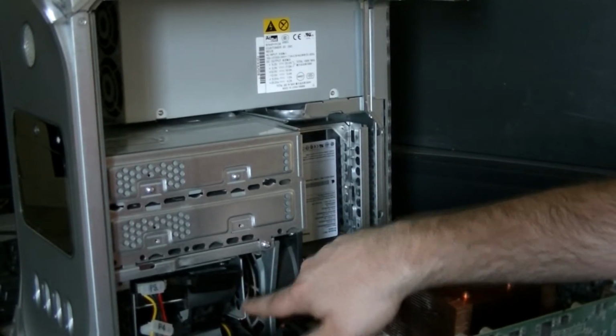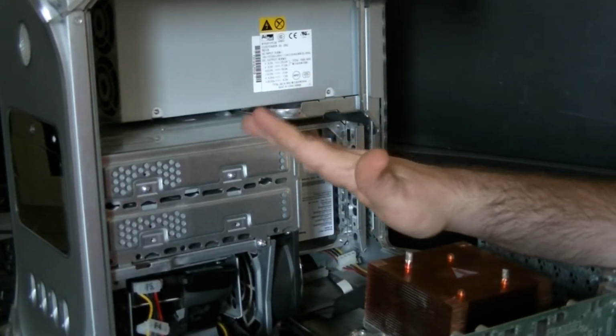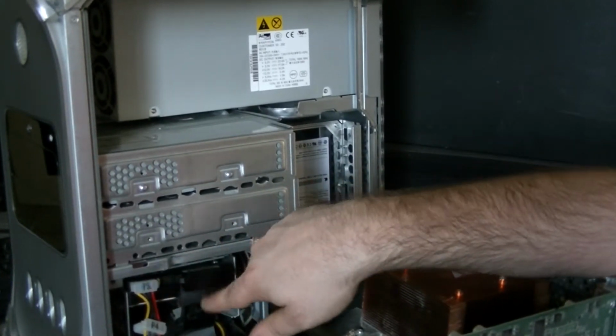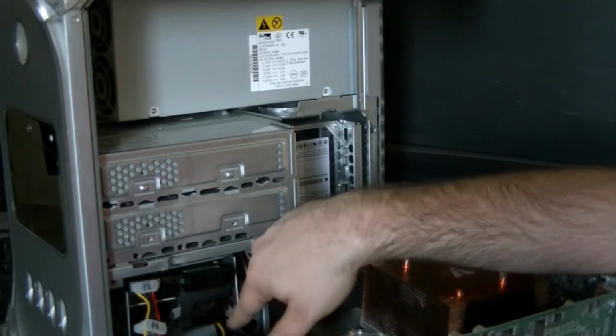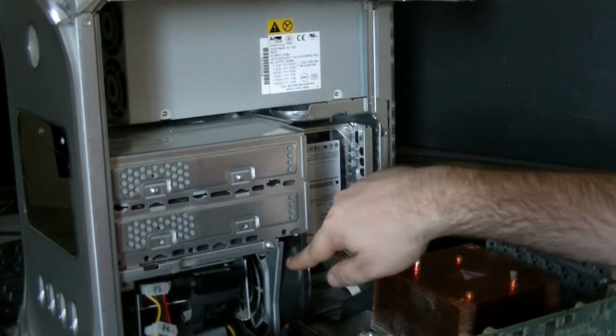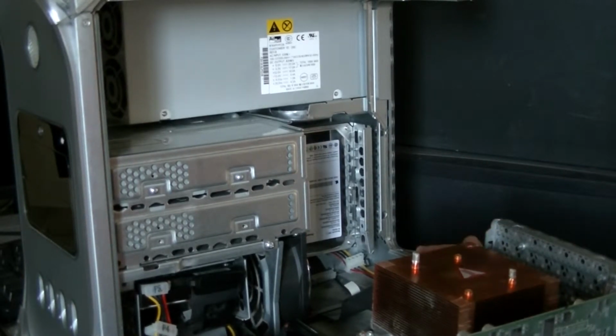You can actually add up to 4 hard drives if you populate them all, which is nice, but the fan here is an intake fan from the front. So technically that hard drive gets warm. If you get 2 of them, it really gets hot. So it'll intake hot air into the CPU and exhaust really hot. So that's not really a good idea.